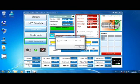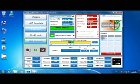So you see that it's flashing from green to pale blue, because the Petrol ECU is detecting the errors. The gas ECU is erasing it now, and due to the fact that the error is permanent, is fixed, I did not reconnect the sensor. We are trying all the time to erase it. So it's been erased, and then it turns on. It's been erased, and it turns on. Okay, this is how it works.